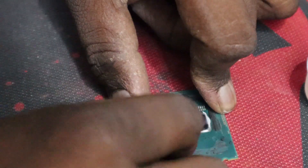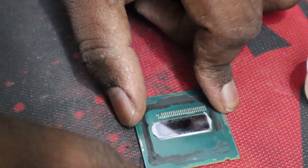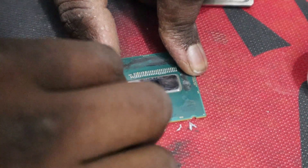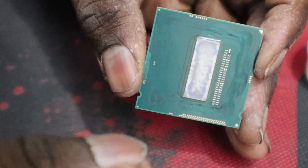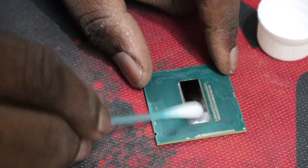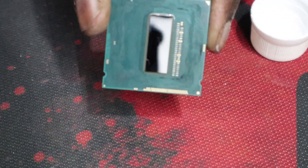You can see the chipset inside has marks due to overheating. Start scraping the sealant slowly with your nails. If you don't have nails, use soft credit cards on the lid, but use your nails on the processor — even credit cards are too hard for the chipset. Don't use any sharp objects on the microprocessor. Now clean the overheating marks from the chipset: take some isopropyl alcohol, clean with the wet side, immediately shift to the dry side for even cleaning until it gets shiny.